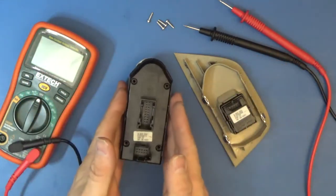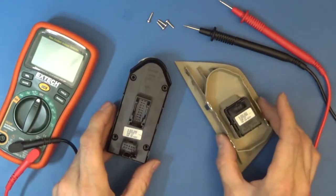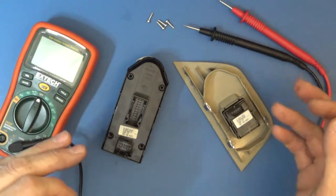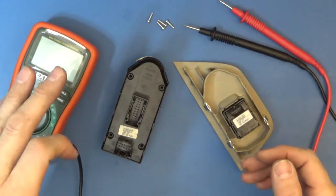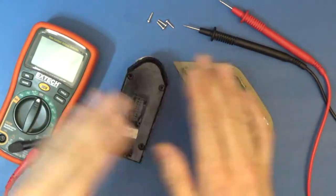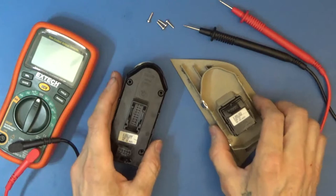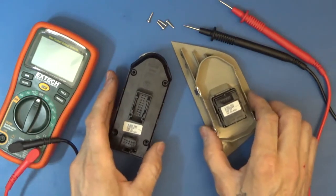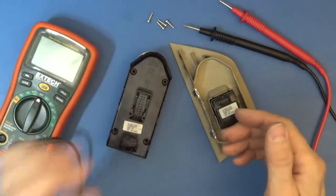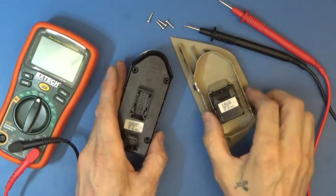So it kind of seems like the switch. Now another thing I read in the forum: in my case it was the passenger side, so I went to the driver's side thinking that switch was broken, tried the switch on the passenger side, and it doesn't work either. You mentally rule out the switches being the problem — why would they both go bad at the same time? Well, what I found out is with multiple switches, if one switch goes bad, they can all go bad. Keep that in mind.